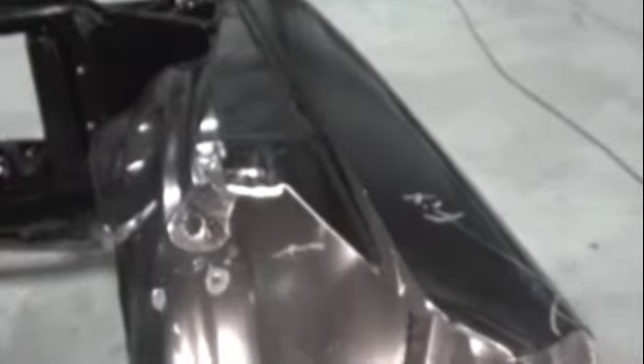We got it back off, I've had to do some welding in a couple places. This was moving everywhere — you can see you can move it real easy with your thumb. The adjustment moves back and forth, it's not attaching to the skin, but underneath the same thing. I had to do this on both sides — just not welded together right. So we're just going to stick a few tacks in it and attach these back in here. Get us a little strength — see, I'm moving it now with my thumb and you can't move it now. Just a couple little tacks, just tighten it back up, do a couple on this corner.